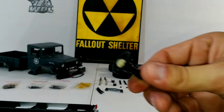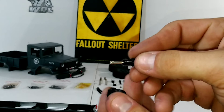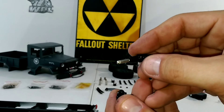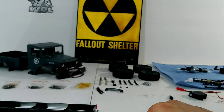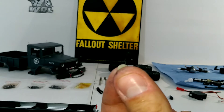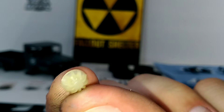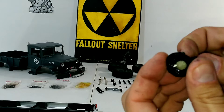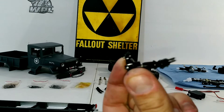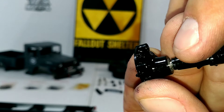The best thing to do with this is just pull it apart, and then go through and put a little dab of super glue. If you want to heat it up, this part will come off and you can put a little dab of super glue on the other end. Just a little dab — if you do any more, you're going to regret it later if you strip a gear, because these are little plastic gears. Once said and done it should look exactly the same. Remember to re-lube it after the super glue so everything's freed up. You can also glue the little white bushings into place.